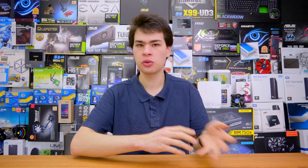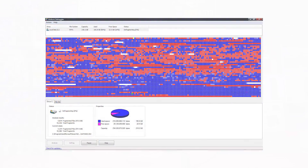This leads us to the next question: why on earth is this even happening? Why is our drive slowing down when we fill it with stuff? There are a lot of different factors causing this problem, but something the internet can mostly agree on comes down to fragmentation. When you put something on a hard drive, if you're loading it up in one go, it's going to load in one chunk. But if you're loading up multiple different things at the same time, they're going to be split into different chunks and spread all over the drive. You can run a disk defrag to push it all into one easily accessible area with large chunks of free space, but a lot of the time these slowdowns come in the form of fragmentation.